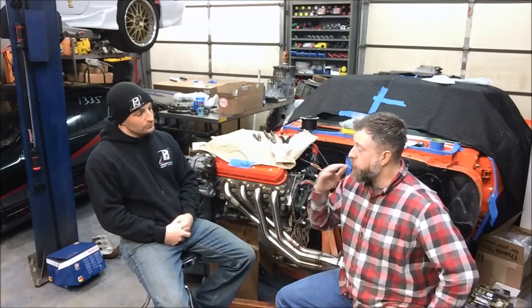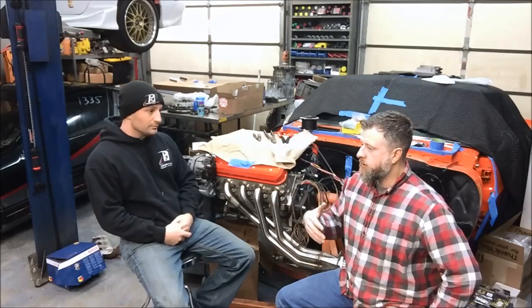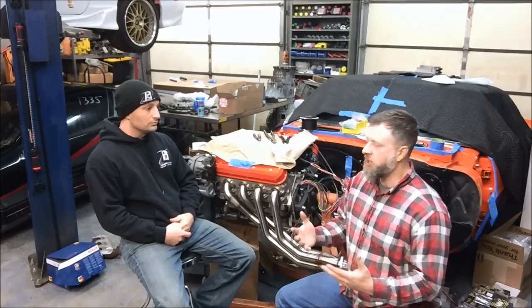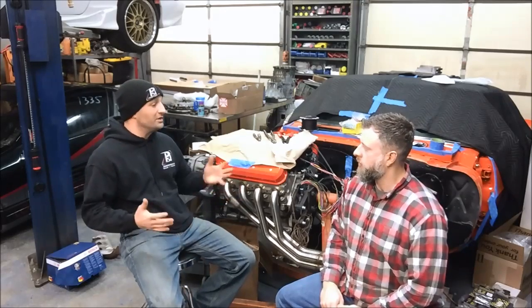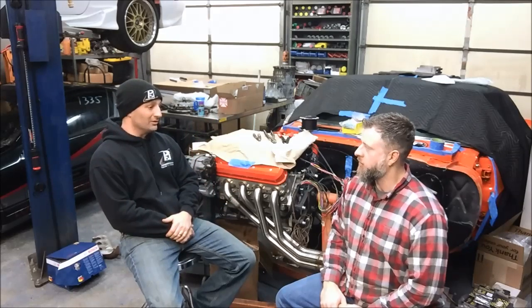From VVT, though, we do support VVT. VVT has been more openly accepted in the aftermarket because there are genuine benefits to power production — it's not just a fuel economy thing. There are VVT cams out there; you can go to Texas Speed or anybody and they'll supply you with a VVT cam. DOD — nobody's really building DOD cams because once you start getting up in that RPM range, that's when you start launching lifters.